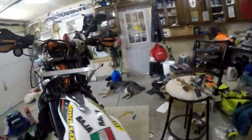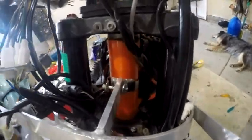Yeah. So I took the bolts off of here. I think it's a little bit over constrained on both sides. Kind of let those flop in that way. I went so far as to, you see this little edge right here? I chamfered that on my disc sander on both sides. That'll make the distance a little bit shorter. That makes that radius the same as what's on there.